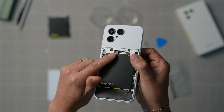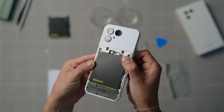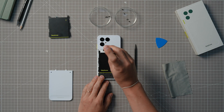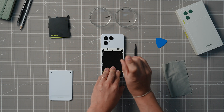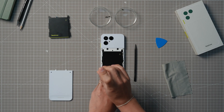Reconnect the B2B connector and make sure you hear a click. Close the connector cover and re-screw all the screws you removed. Unlike our earlier editions, the battery on the Fairphone is not meant for frequent swapping and should only be replaced when it has reached its end of life. This could be anywhere between two and four years after you first use it, depending on your usage patterns.